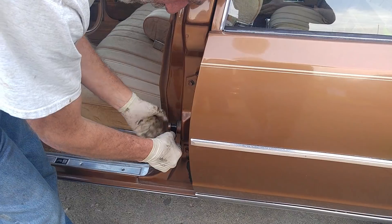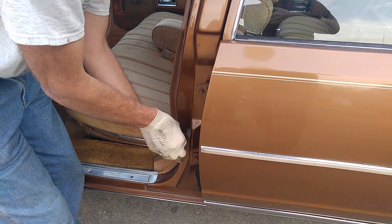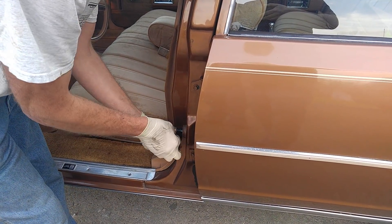It was originally a nylon bushing and it broke after a year or two or three — every single one of them. You can wrap it very carefully with electric tape. It lasts about five years. It's amazing — a little bit of electric tape will make the vehicle operate better.